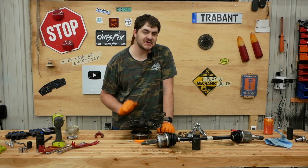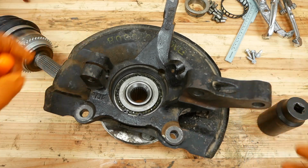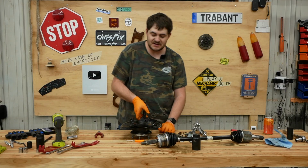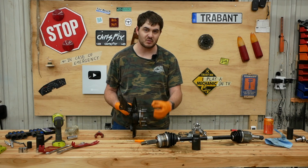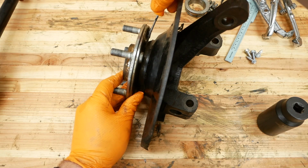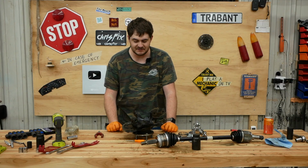I have some concerns about these wheel bearings. They have no shielding in them. There is nothing keeping the grease in the rollers and the dirt out of the rollers. At least on the front side of the wheel bearing where the hub is, the hub provides some direct shielding to the rollers, even though there is still a gap between the hub and the carrier where dirt can get in. But on the back side of the bearing, there's nothing at all.